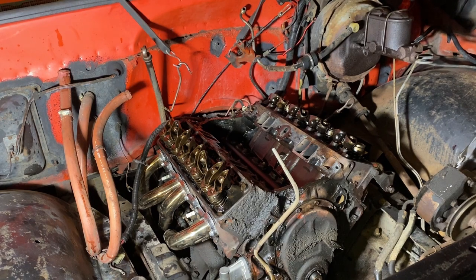I think I'm gonna see pretty much all the same wear on the rest of the lifters. But I wanted to show you that lifter because I knew that one was gonna be pretty raunchy. So, I'm gonna continue to pull these lifters out of the bores. Then I'm gonna get this thing up, drain the oil, pull a pan and a timing cover, and hopefully I can pull this camshaft out tonight yet before it gets too late on me. Let me dig into this, get this taken care of so I can get this camshaft out for you guys